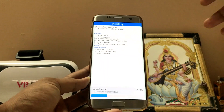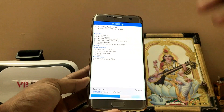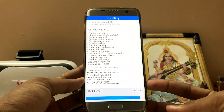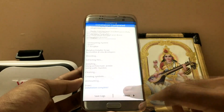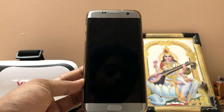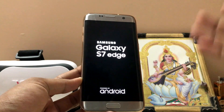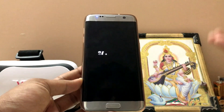The kernel will be installed and the first boot will be very awkward — the device will keep rebooting. You don't need to wipe anything; it's just part of the process because we're changing the RAM disk. The kernel installation has been completed — hit finish, then swipe to unlock and reboot the system. On the first boot the device will give too many hiccups and may seem unstable.